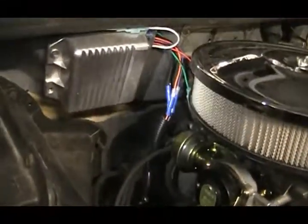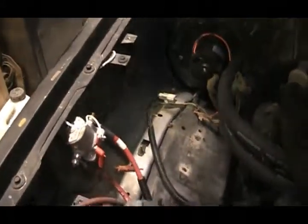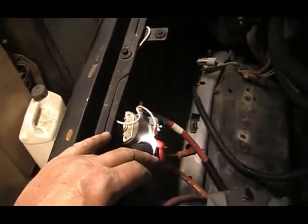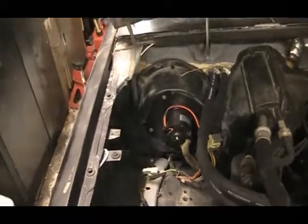It pretty much runs pretty good. I had to put a thermostat in it and a fuel pump — the fuel pump started leaking. It was an engine-mounted fuel pump. You'll notice there's quite a large cavity right here. That white wire right there is the one that's power under crank, and I just loosened this little nut on the starter relay. There's a ground wire there that goes down to the frame that I don't need, and a power wire there that I don't need. I put a new blower motor in it too — the other one was squealing.